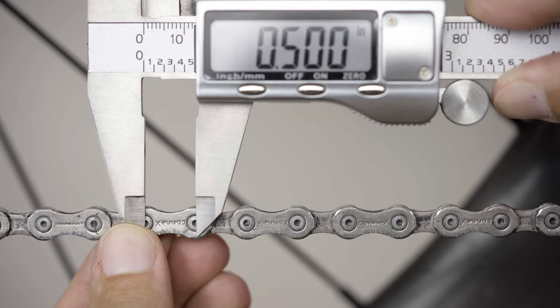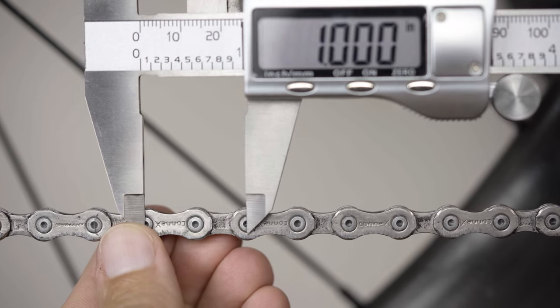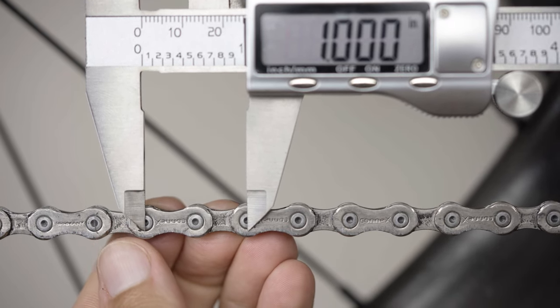There are some exotic exceptions, but most chains on the market are produced with absolutely the same standard pitch — simply the distance between pins of half an inch — regardless of manufacturer, age, drivetrain type, or anything. Thus, a full link consisting of a set of outer and inner plates plus three pins measures precisely a full inch between pin middles. As the chain wears, this stops being the exact truth. The chain inevitably stretches, or in other words, elongates. Each link is now an inch plus a tiny something, very hard to measure.